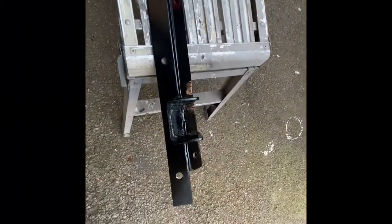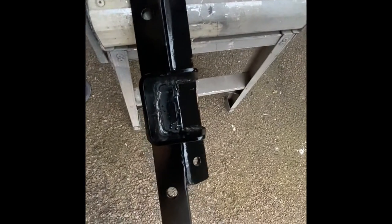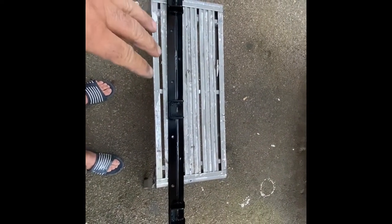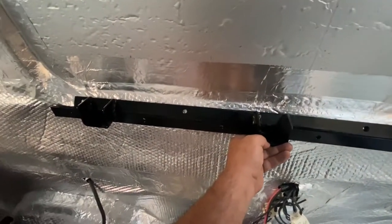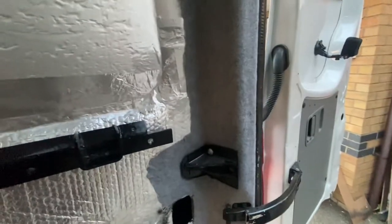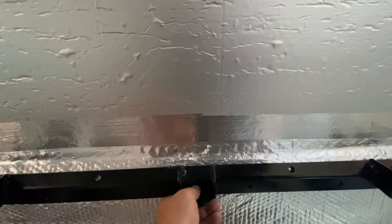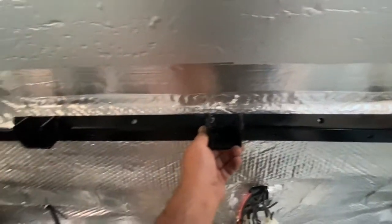It looks like some seagulls or pigeons came down and did some rubbish welding all over the place! My welding skills are terrible, especially arc welding — I just cannot master it. If my dad was still around he would have whipped this together like nobody's business. It doesn't look wide enough for a double bed, but there is another bracket going on the back. Let me lift it in place to show you where it's going to go — just there, rivnutted to the side. There'll be another bracket at the dimple which will take the weight further across. So that's my bracket — I've just got to replicate it for the other side.